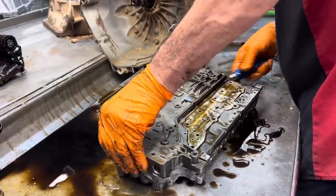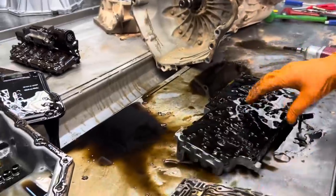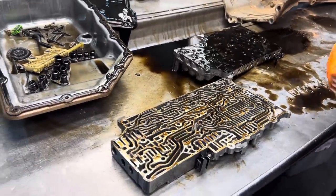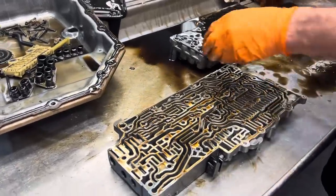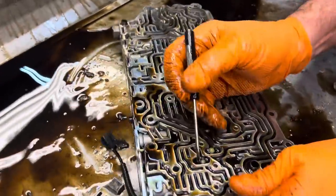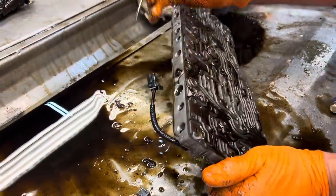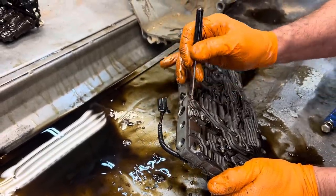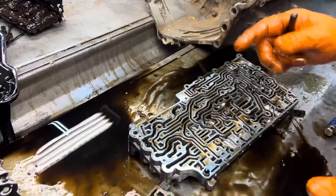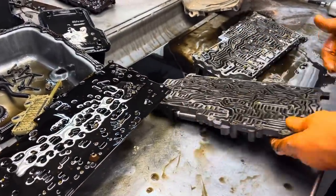I'll get this off there. The main thing on this, the valve body part, what I like about Sonnax is they give you all the end plug caps that have O-rings and stuff on them. So any one of them that's got a shuttle valve through here, this one, this one, this one, this one here, Sonnax supplies the end plug kit with an O-ring on it to seal the ends of these off right through here. They offer a bunch more things too. So their zip kits are really nice. Not hard to put in. I think any amateur could do it.